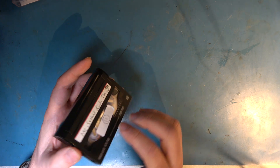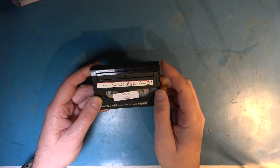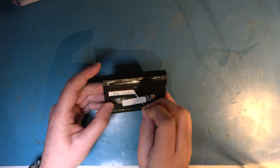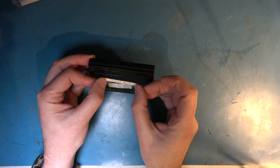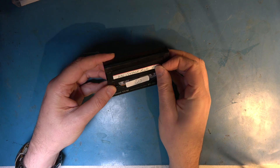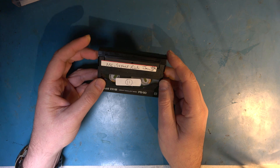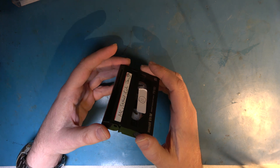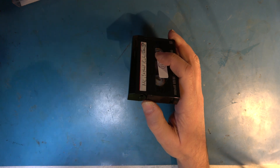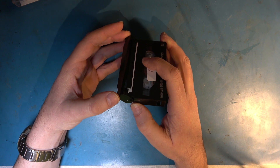But something can happen, and there's sometimes a reason for it. This particular tape is very badly designed — it has a place for a label right in front of where this mechanism opens. That's fine if the customer treats it properly, but if the customer is a bit sloppy and sticks a label there, there's a hazard that this will not ride over the top. Or worse still, the customer sticks it there not realising the door is relevant. Now you've got a problem that won't open at all, and this can be very damaging. On some camcorders it'll just jam, but some bigger mains machines can get into a position where they're sort of half open, half closed, and it can jam the front loading mechanism.